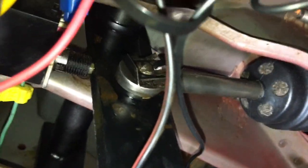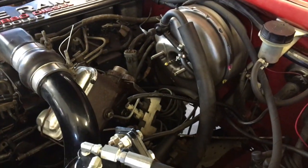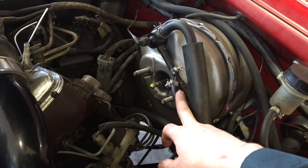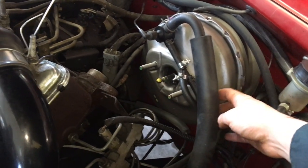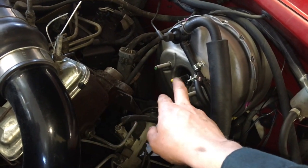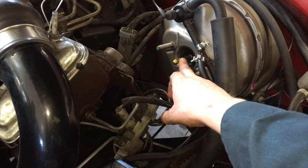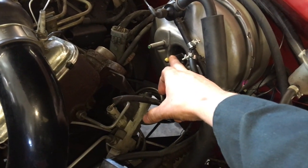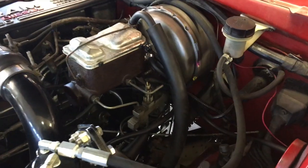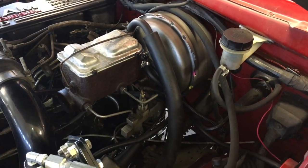We're also making sure the brake light switch is working properly. Back on the engine bay side, we've hooked back up the check valve, the main vacuum hose, the cruise control hose, and another vacuum sensor hose. Note that the new vacuum booster should come pre-adjusted for push rod length, but you can double-check other videos online for that. We then installed the master cylinder back onto the brake booster, confirmed everything is connected, and tightened down the master cylinder bolts.